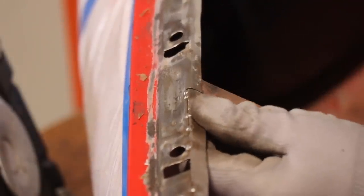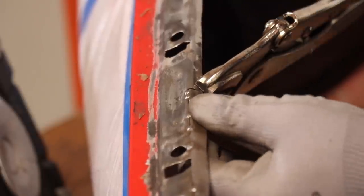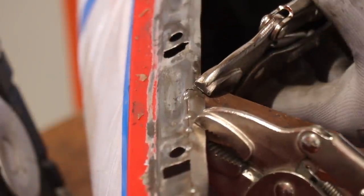When a welding spot is put towards the end of a seam, it's a bit prone to leaving a half-circled hole. One good way to keep the melted material from spattering off is supporting it with a copper plate.